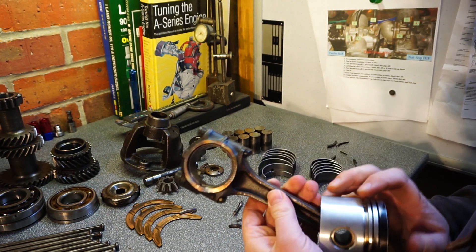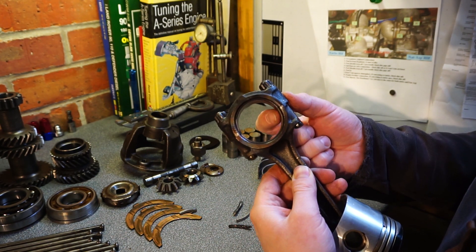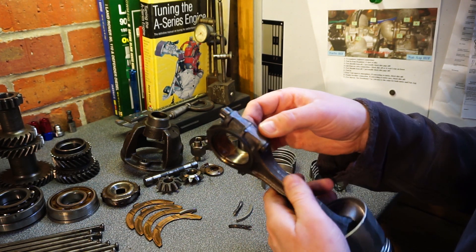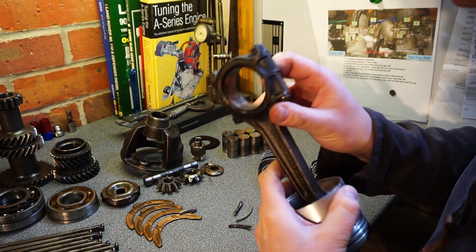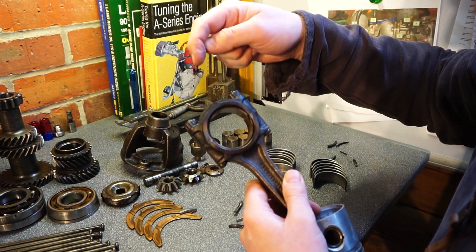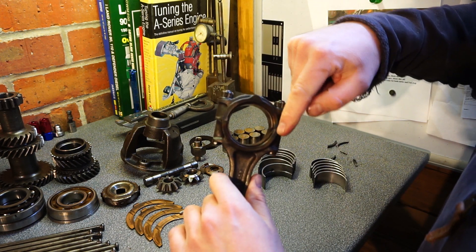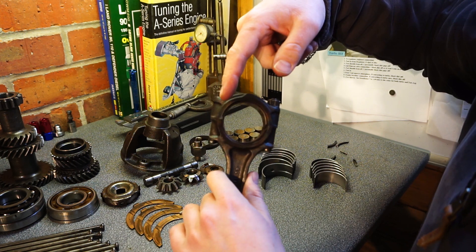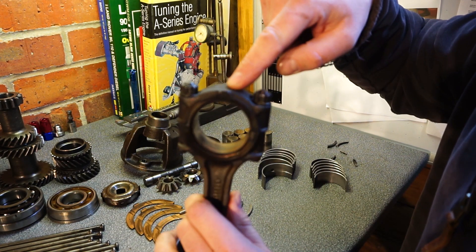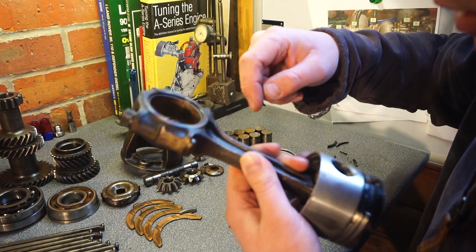Then I looked at the big end on this one - you can probably just see discoloration. This was so tight the whole big end has gone blue. Why? Because some numpty who put this engine together has mixed up the rod ends. These must be matched to the rods. There's an offset of nearly half a millimetre between the inner and outer, which meant it was running really tight on the crank, causing it to heat up and destroying the bearings. You can see the colour - that's straight through to the copper. Terrible.